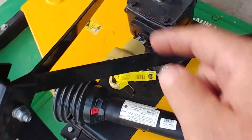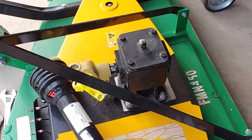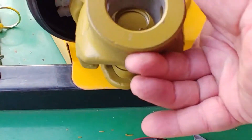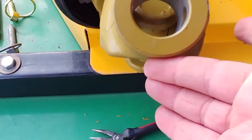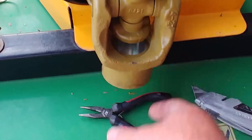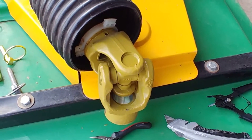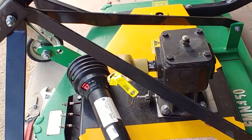So this morning I have to put that U-joint onto this one. It came with a smooth one because all the newer stuff has a pin through here and that's how it transmits power. But that one is smooth and I need a splined one for this mower.